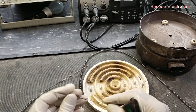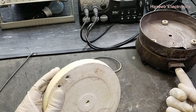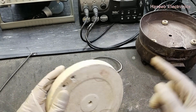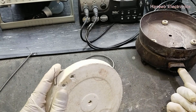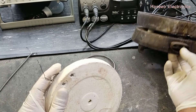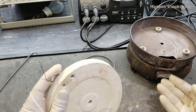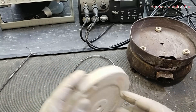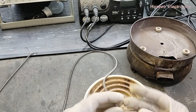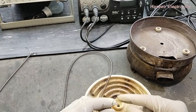Now I will take a steel wire. If we connect this spring directly to the terminal, the heat will transfer into the brass terminals and then into the plug — it will heat up and cause sparking. So we will add a piece of steel wire to this one.